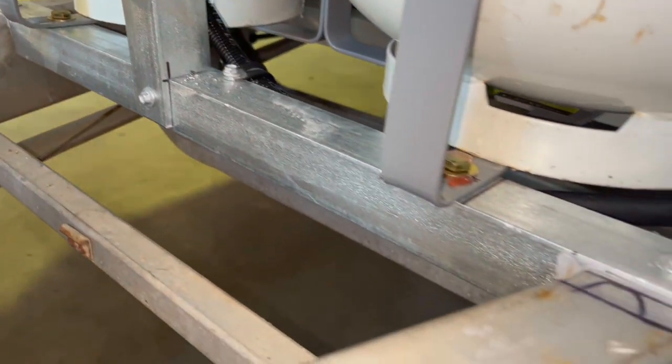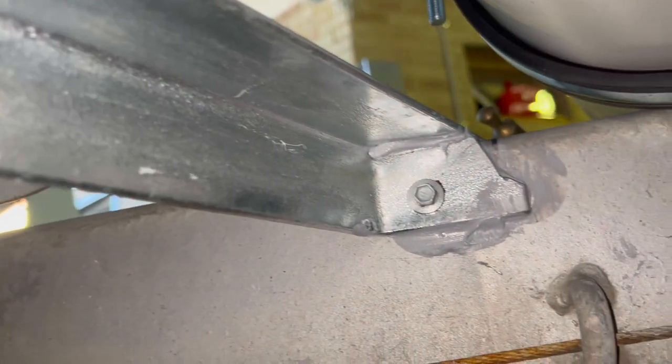All sorted - thank goodness. The bottle holder's come up really good. I used some 40 by 40, three-mil galvanized steel. I folded it a special way underneath so there are bolts that go into the chassis this way and also from the top. I also used automotive adhesive to hold it down - so even if you take the screws out in the future, it still won't come off. Then we used eight-mil bolts to bolt down the holder, and the two brackets are bolted together. Really rock solid, that worked out really well.